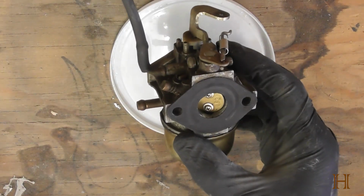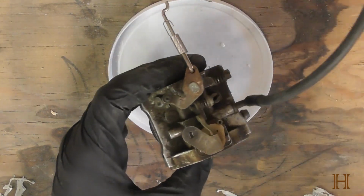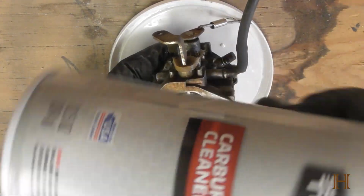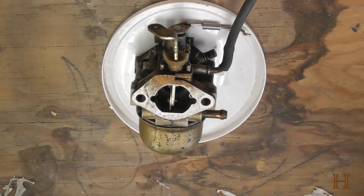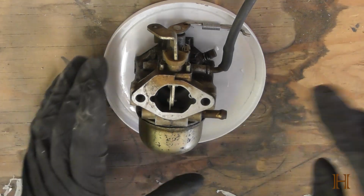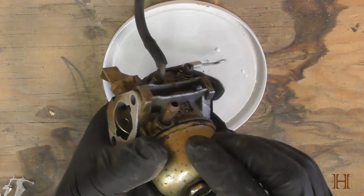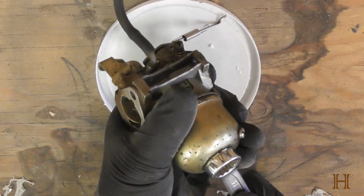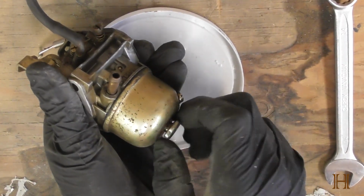As you can see, I just want to go over the major parts of cleaning, where we're going to use some carb cleaner. I'm not a sponsor of this brand, and just a bit of a toothbrush that'll probably start to disintegrate with the carb cleaner, but that's fine, and get these things a little bit cleaned up to make sure there's nothing gunked in there. So basically we're going to start by removing the bowl down here. It's got this 14 millimeter nut down here, which we're just going to loosen, slowly take away.